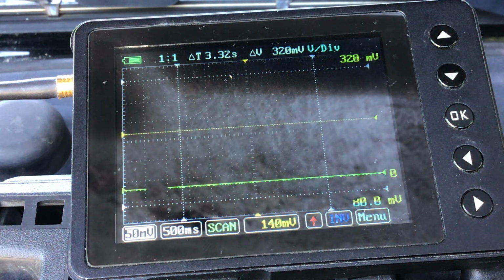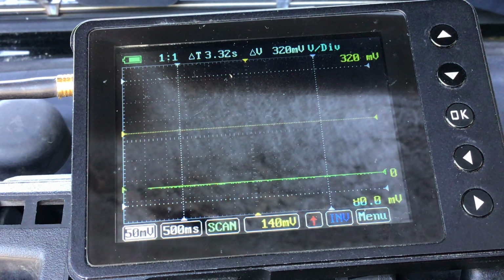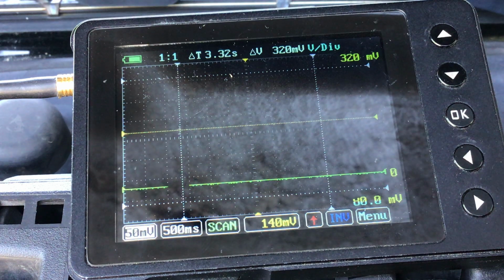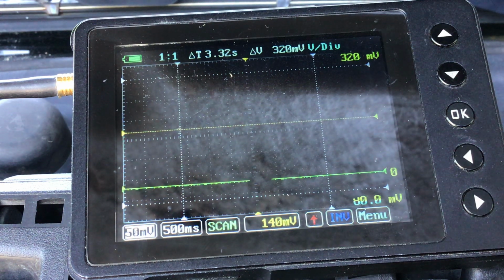If you're in a shop and you have 90 psi, take your air nozzle with a conical tip, I wouldn't be afraid to do that too. Just get it into a compressor and flutter the air, because these delta sensors respond to change in pressure. I think you'll stimulate the sensor more to get a true reading on the delta sensor. The absolute sensor, the WPS, would pick it up either way, but nonetheless, you want to pulse that air into that cylinder, and should it get by an intake or an exhaust valve, you'll see it on the respective transducer that we have hooked up.